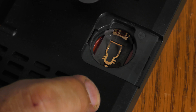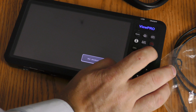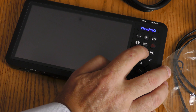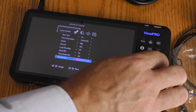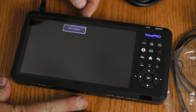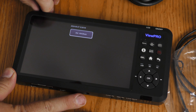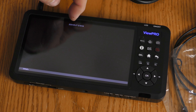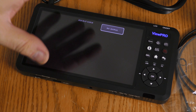Installing the CR2032 takes a little effort — sliding it in and nudging it works. That tight fit means it probably won't come out easily either. To bring up the menu, hit the little house button, which you'll also find on the remote. After setting the date and time and confirming it reads correctly, unplugging and replugging the device confirms it still maintains June 7th and the correct time. Having the button cell installed is important for keeping your menu settings, especially your clock, maintained.